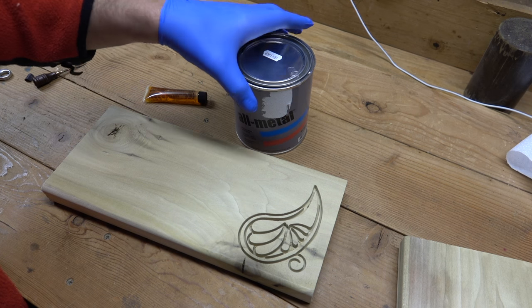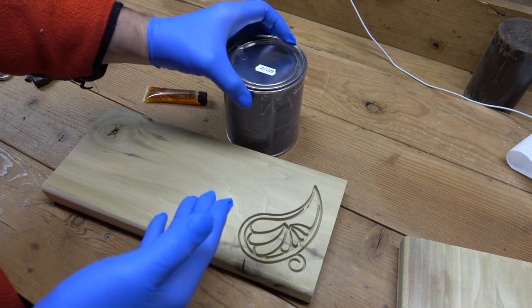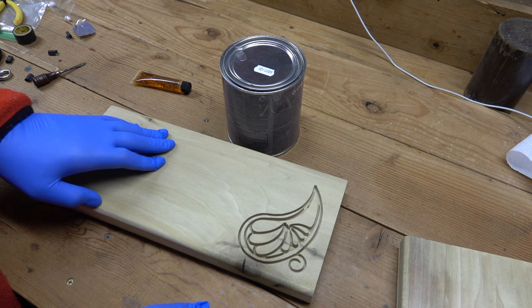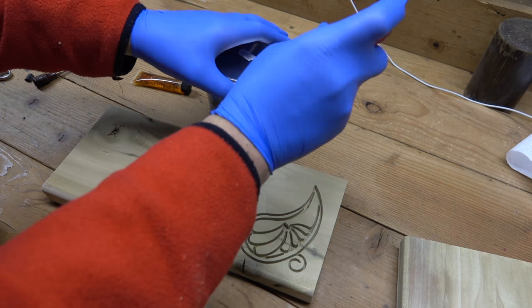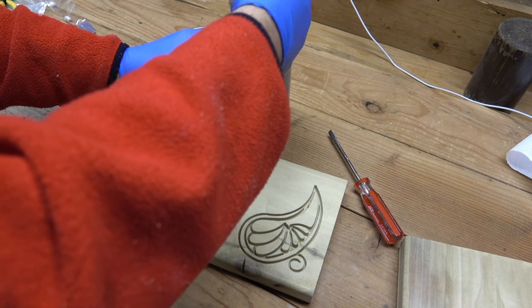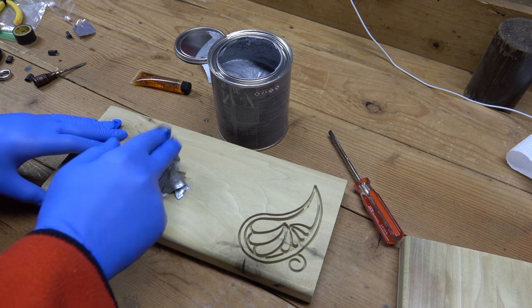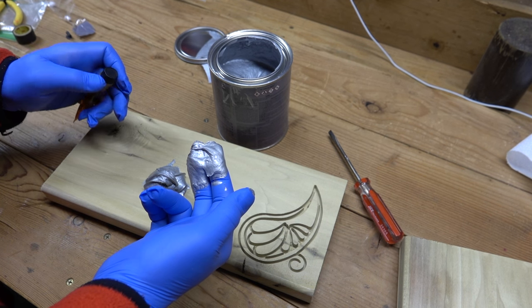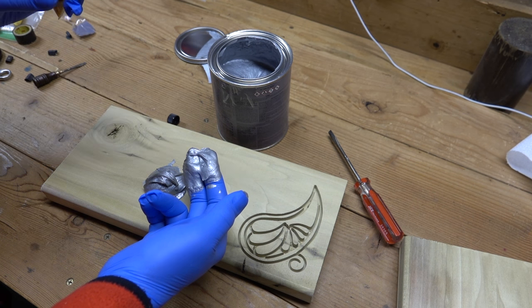Essentially, it's a metal repair for aluminum, metal, whatever, sheet metal. And the instructions say take about a golf ball size, use about 12 to 15 drops of hardener, spread it in, sand it off, see what happens. So let's see how this works. That sort of looks like half a golf ball. So for a golf ball size, you should use 12 to 15 drops of hardener.